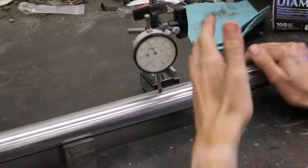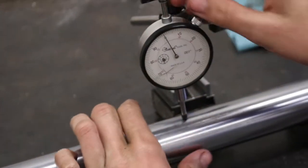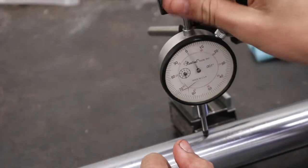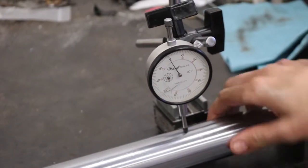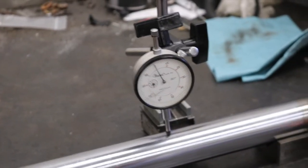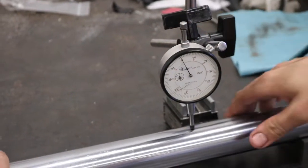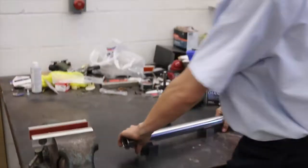We're going to measure 3 different parts of the fork. What we're looking for in our dial indicator is deflection of the needle. So that's zeroed out. Just lightly going to move it with our hands. It's not too bad. I'm going to move it over a little bit. Zero that again. Check deflection. Now that our fork is within specifications of 4/1000ths of an inch, we're going to go back to the table